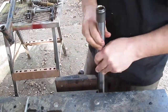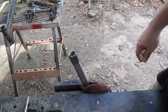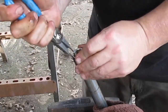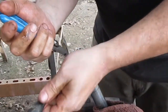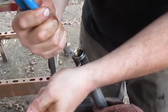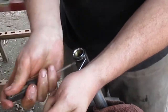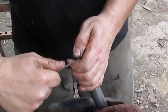This one's a little more difficult. It's the kind that doesn't have actual holes — it has just notches where you've got to get your pliers or snap ring puller down into. Same basic deal though: spread it apart, try to get a pick underneath it and pull it above the groove. Then I use a succession of screwdrivers to just pull it up, pull it up.